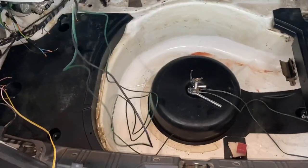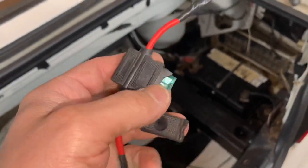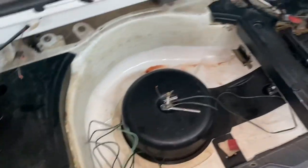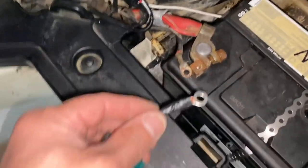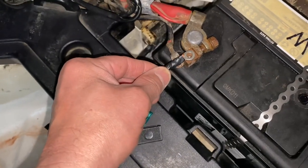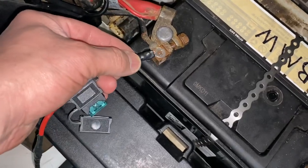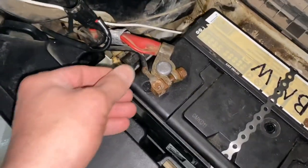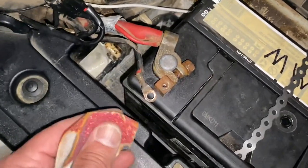There is our fuse and the wire that's going to run all the way to where our switches are. For now take the fuse out — so in case you touch that wire to the body of the car, the fuse doesn't blow and nothing shorts out. We're going to hook the fuse up right here at the positive terminal. You've got to grab a piece of sandpaper because see how corroded this is — that's no good. It has to be bare metal, perfectly clean, to get a good solid positive.